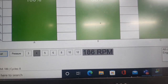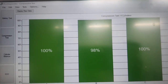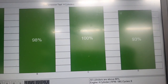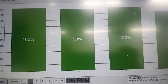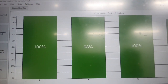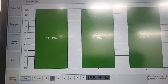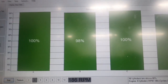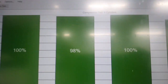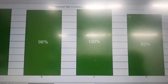That's how you carry out a relative compression test. Within a short space of time it tells you what is wrong — if there are any compression losses it will show you by this bar graph here. You are just using the battery, and during cranking it tests and shows you which cylinder is good and which is bad. I didn't take out any spark plugs, I didn't connect any compression gauge — it's just quick.